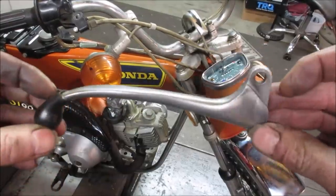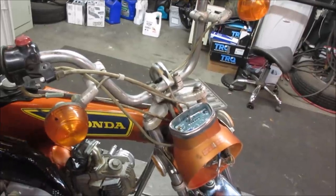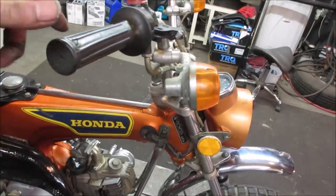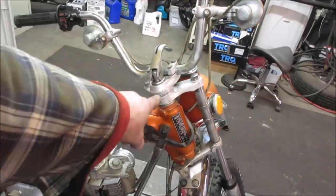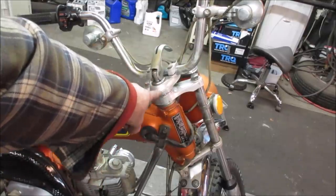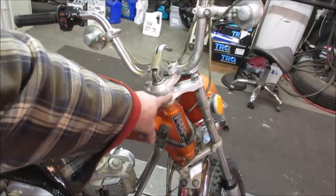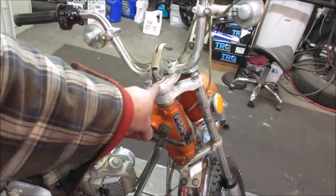That's better. So one thing the bike's having a problem with, I noticed when I was up there, I turned the handlebars and it is very, shouldn't be like that. It's like the bearings are clicking through their location. So let's go open up the triple tree and get to the bearings, see what they look like. I don't know if we can just spin this whole assembly off. Yeah, we gotta take this apart anyway, no matter what. And I'll get a towel or something. We'll lay the handlebars on the front, and we'll start digging our way into there.